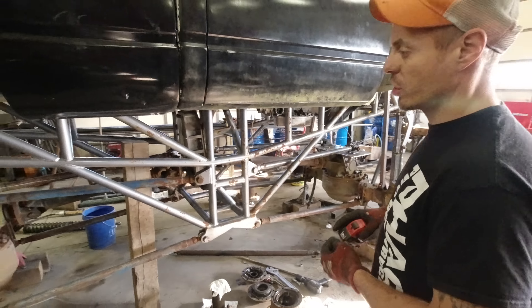Now we've got this kind of figured out, and you can do it any way you want - bend it straight, or do a V. I run a V because I just have a manual bender, simple V and tie it in. That's the easiest subframe there is if it's just you by yourself. Other guys can do a compound bend. Then you go to the axle and figure out where you're going to put all of your link tabs - up on top and down on the bottom. This is called axle separation. From where that bottom bolt is to where that bolt is up top is almost 20 inches - that's 20 inches of separation.